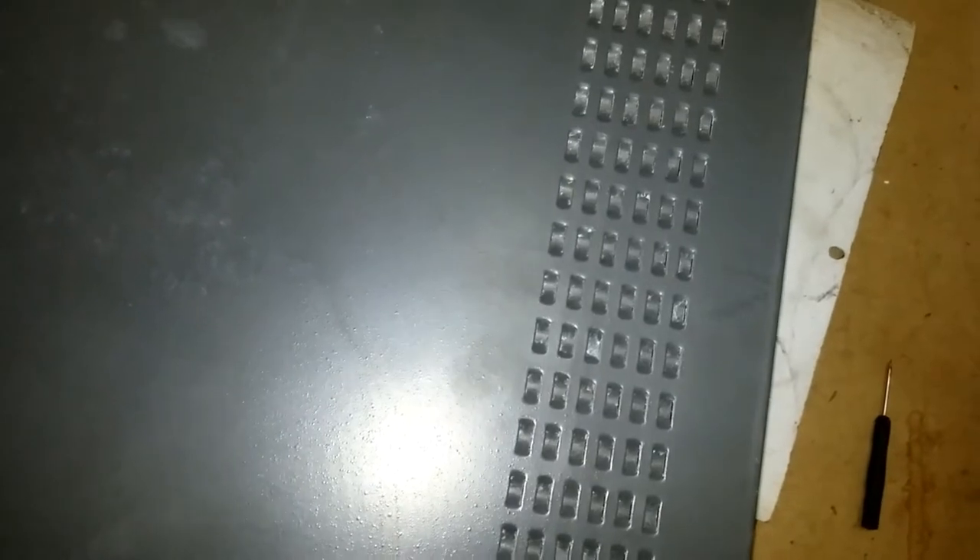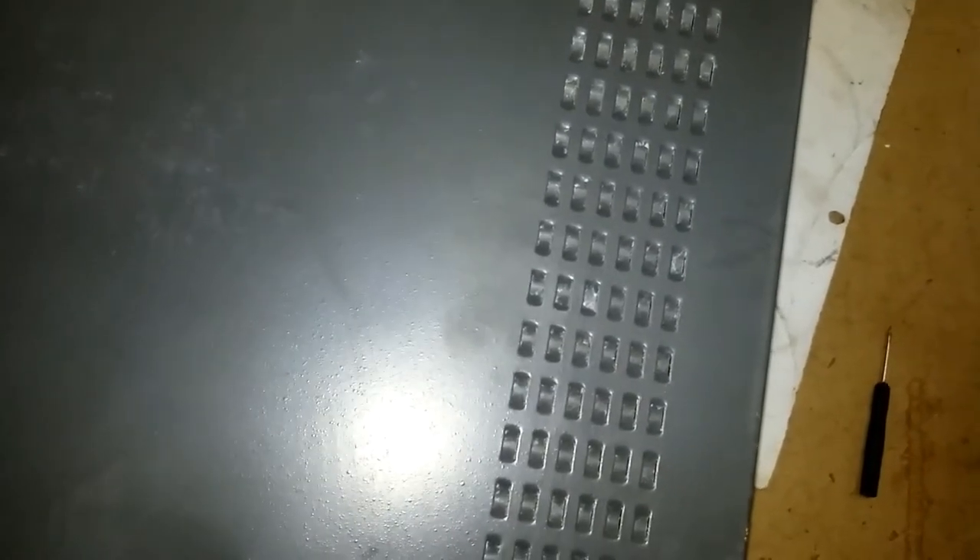So this is the way to go about changing your computer battery, which is a CMOS — it holds the time and date. Once that battery is weak and you power up your computer, you would have to change the time and date each time. It may tell you to press F1 to skip the setup. You press F1 and it would boot up, but the time and date would be incorrect. You change your battery to resolve that problem.